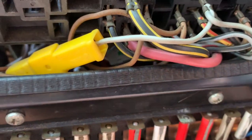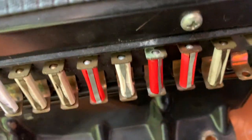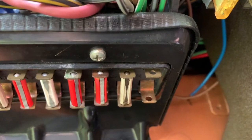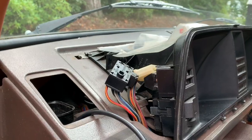I've disconnected the screw that holds the fuse panel here and thought it would drop down, but it's not without wiggling things — and I'm worried that's going to make more problems. I've been fiddling with it for a while and having a bear of a time getting to the back of fuses 11 and 12 without messing the panel up. I think temporarily I'm just going to go to one of the leads on the fuse to get power to it and get it all running, and then later down the road see if I can get back there properly.